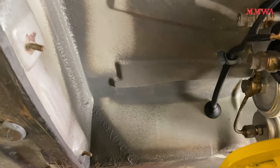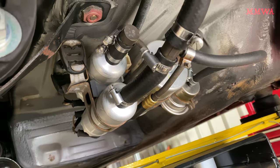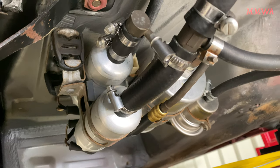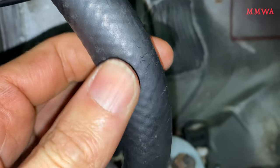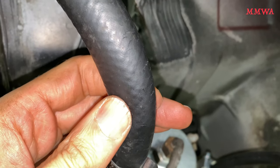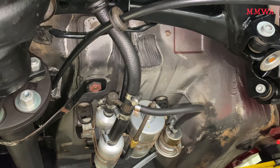It's still nice and clean back here. Unfortunately, that's where the good news ended. As I was about to start this job, the first thing I wanted to do was pinch the suction line from the tank, and much to my horror, I saw that that was not a good idea. After only two years, the rubber is already starting to decompose. It's ridiculously soft, and you can see these cracks starting to form. If that's squeezed too hard, I dare say the inner layers will start to crack, and then you'll get weeping of fuel to the outside world.